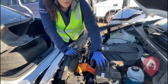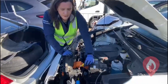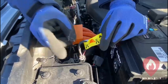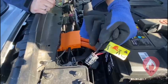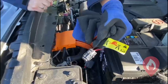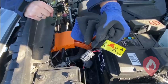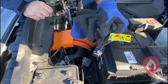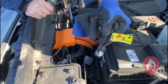Here's our 12-volt battery and the fuse box they're talking about in the emergency response guide. But here at the front we've got a cut loop — we can tell it's for emergency response because it has a firefighter helmet on it. The beautiful thing with this particular cut loop is it also unclips and can completely come out. We could cut through it to isolate the high voltage systems, or simply unclip the whole thing. That way, if the vehicle's fine and there was no emergency, we can clip it back in and the vehicle's good to go. We love this system — it's used by Kia and in some Hyundais like the Hyundai Kona, but not widely used across all makes and models unfortunately.